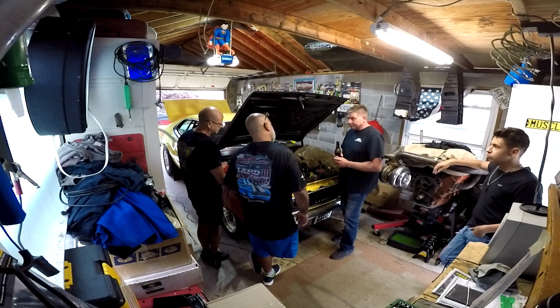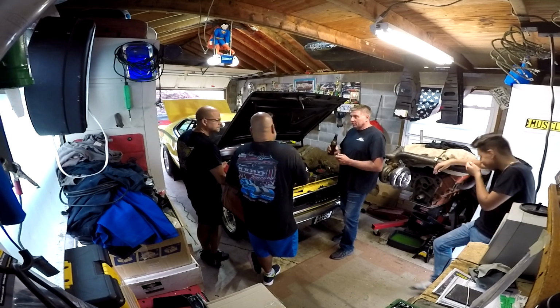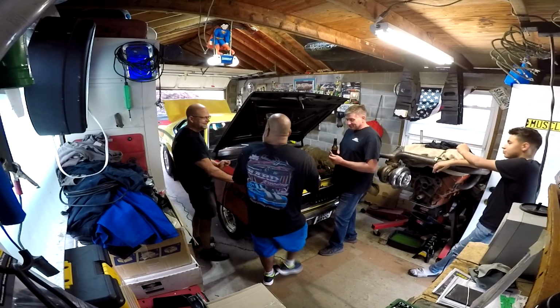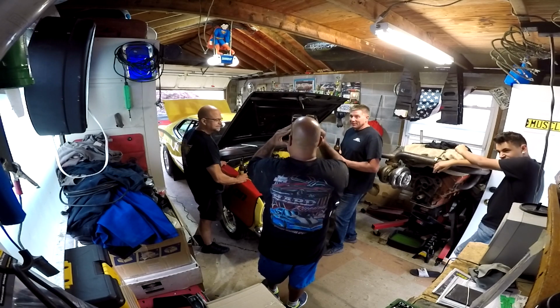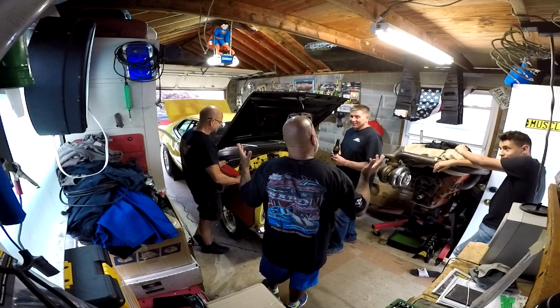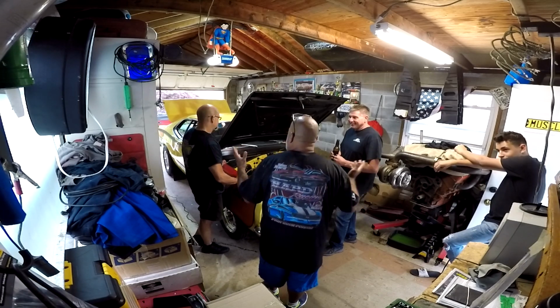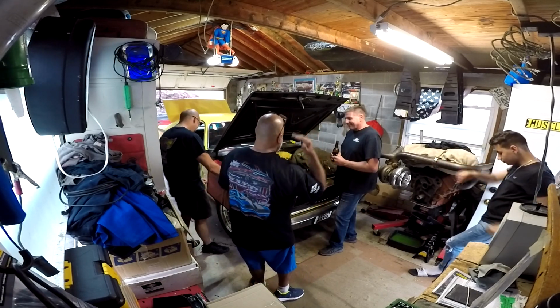I don't know. There's not a lot right now to read. I can't see right now. Did he tell you what I did the first time? I forgot to swap the plugs. I have hot plugs in there. And the car, it took the pass, so I'm like, oh my God, I'm gonna take them out and they're melted. I pulled all 8 plugs and I'm like, what happened? Nothing happened. Oh, thank God, nothing happened. So then I put the cold plugs in there and the car feels great.